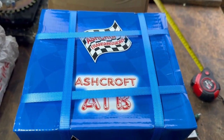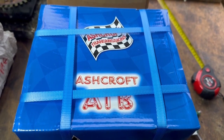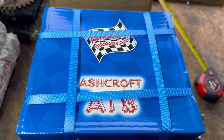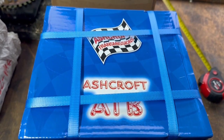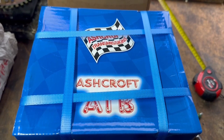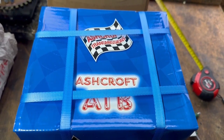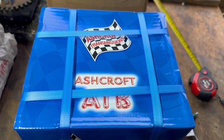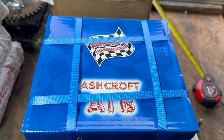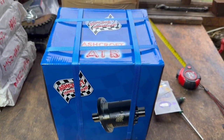In a road vehicle, you go ATB with gears, because if you put a plated LSD in a road car the plates will wear because of the mileage. With a geared ATB, that's not an issue. They're set from the factory — fit and forget, other than normal oil changes. With an LSD, there's lots of fiddling regularly, resetting the preloads, clamping, and ramp and descent angles. So let's see what we can do with a 110 ATB — the strongest we can build.